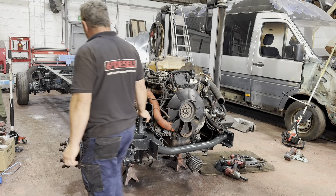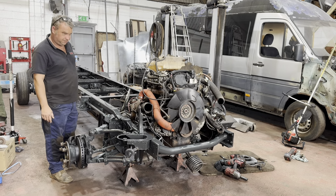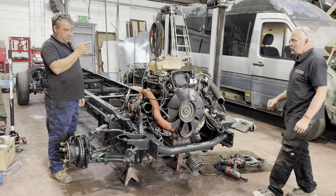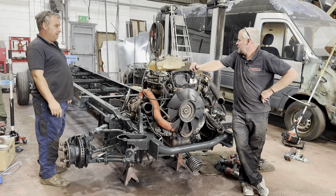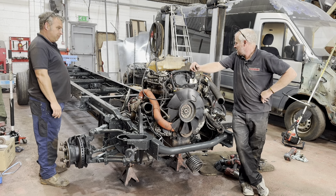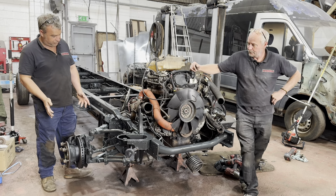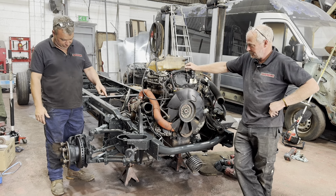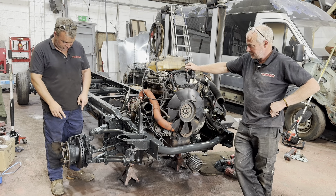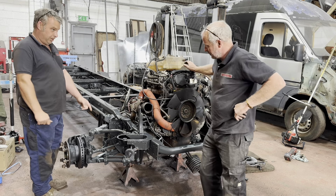Progress has been made on Simon's very large Iveco. Fudge is not far off finished on the cab — got about a day's worth of slight adaptions left. So far we have had a timing chain, all the front suspension apart because most of it was rubbish — new rubber boots, track rod ends, discs, wheel bearing check, caliper overhaul and paint, new discs, and new pads. New brake pipes because they all broke.